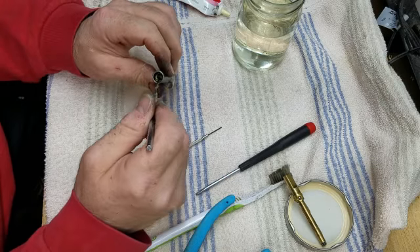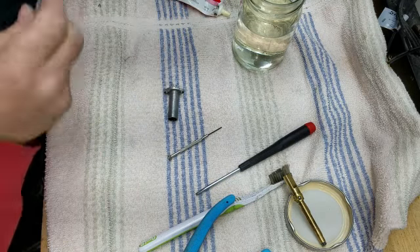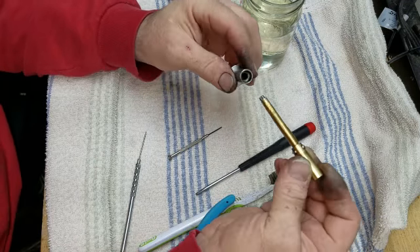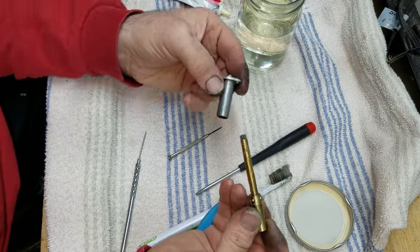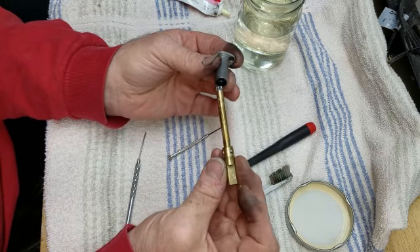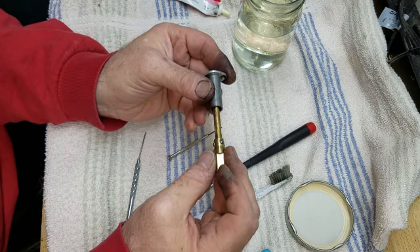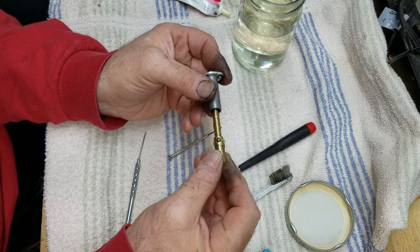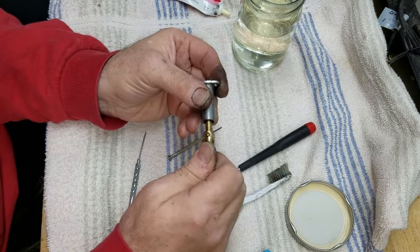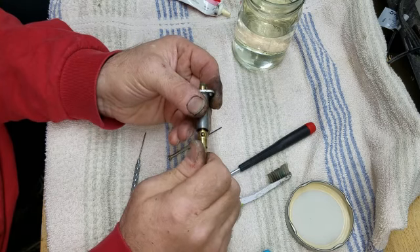This isn't like a record player where you want to put only barely enough to make it work — because on a record player, that grease collects dirt and dust and gets nasty. But this is semi-sealed when it's all together. Remember, it mounts with these two screws up against the plate, the tuning knob on the flatted end, and the gear on the other side of the plate. I might wind up pushing that little mushroom head in a little bit against the spring if these balls will not pop in. There's a little bit of rubbing as I push this in — I'm glad I lubricated it.